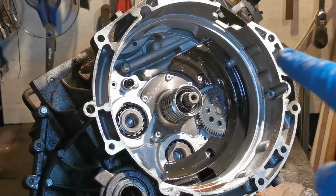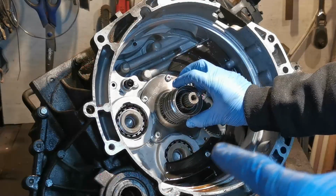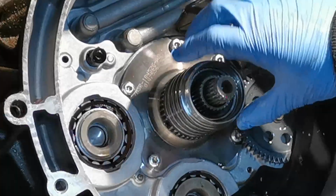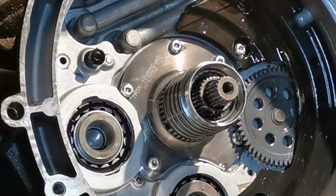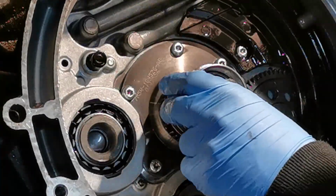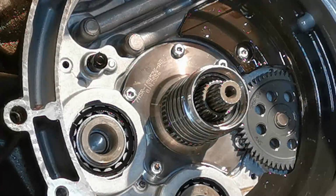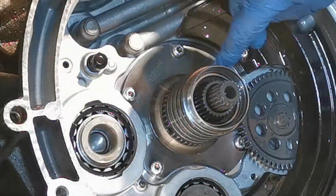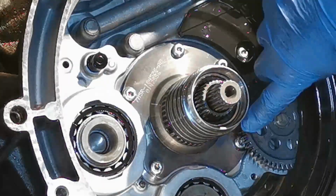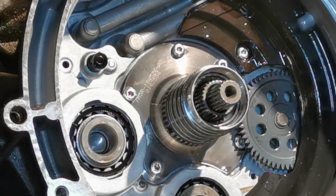So yeah, you've got the oil pump there. These are the ceramic rings. They need to be changed as well, don't forget. They're the oil pressure ones. Then you've got this plate. What's that plate for? That's just to hold everything intact, hold this lot where the pressure is. Under this plate there is another seal, like an O-ring, like a gasket, and you need to change that gasket as well.